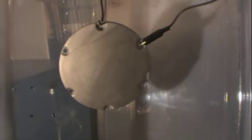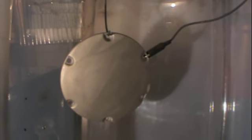So you definitely want to try and cover threaded holes if you can. I'm not too worried about these holes here though. That's pretty much it. I think we're ready to powder coat. So I'm going to give it a charge. You can see that green light's on. It's charging. Let it charge for a few minutes, or a few seconds anyway. And as long as my pressure is set right on the compressor, that should be good. Give it a try.